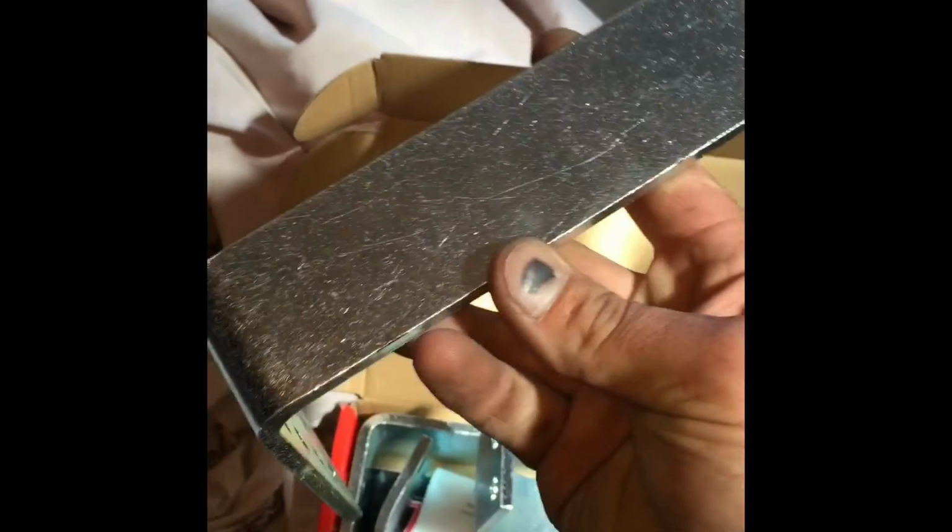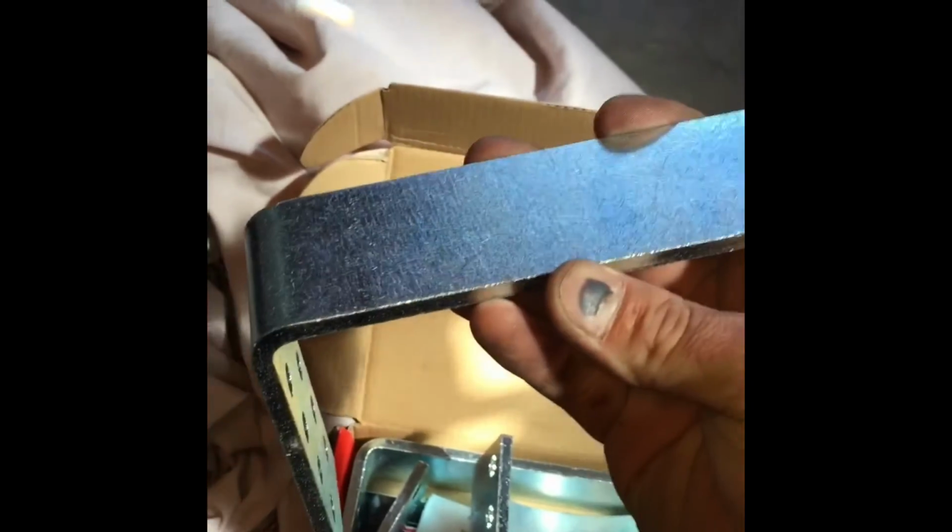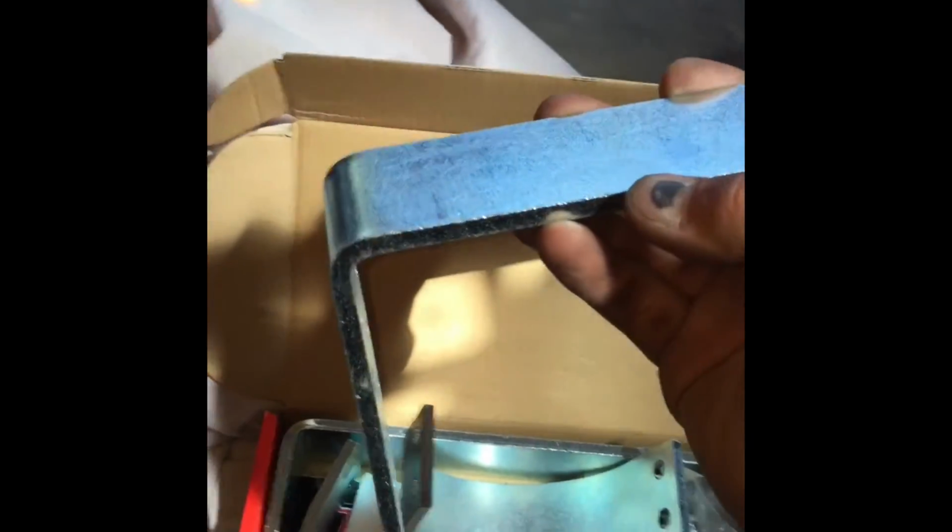And I also have to get a drive shaft loop put in. I'm gonna attempt to do it myself, because there's a little cross member underneath there right by the front U-joint, like all the G bodies kind of have. There's a little brace going across underneath the drive shaft. If I can make these brackets mount up to it, even if I have to drill a hole in it to match them up, then that's what I'll do. I mean, why not? Then I don't have to weld on or drill through the floor. So, should work pretty good.